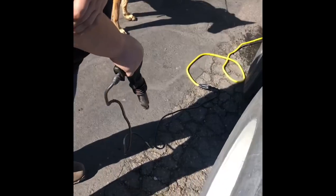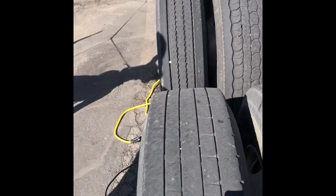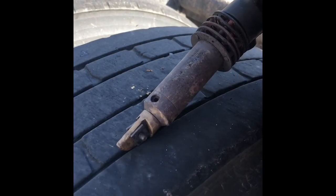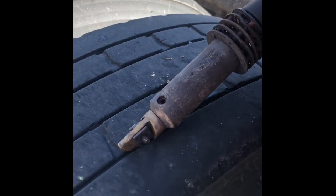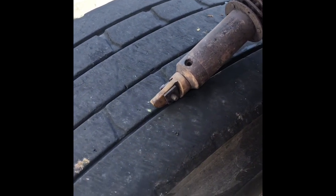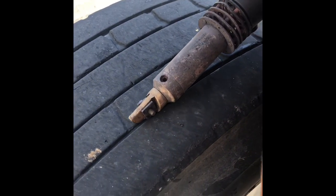When it gets hot enough we're going to start cutting these grooves out. I don't want to touch it because it's starting to smoke — it's getting hot. That's your cutting blade right there. You loosen that screw and you can slide your blade depth. I think that depth right there is about what I want. That's the part that cuts a groove deeper into the tire — it takes a little muscle.